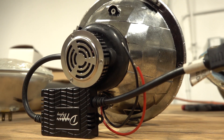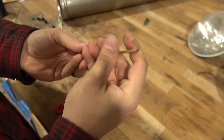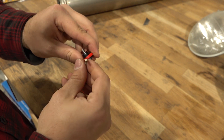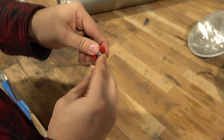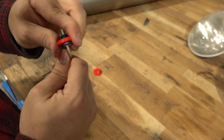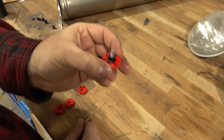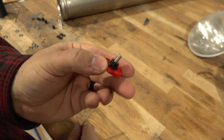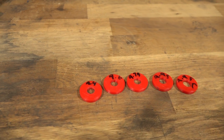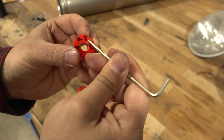The first thing I needed to figure out was how the assemblies would mount to the fiberglass. I knew I wouldn't be able to access any of the hardware from the front side, so I started experimenting using rubber well nuts. As the bolt tightens, it pulls and expands the rubber against the backside of the plastic, keeping everything in place. I think these will work really well because of the rubber isolation — they're commonly used to bolt fender flares on cars. I printed test pieces in a bunch of different diameters to see how well they grip the plastic, and I've also added a chamfer to help give a little bit more surface area for the well nut.